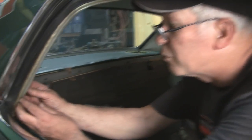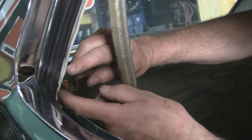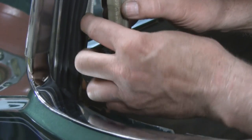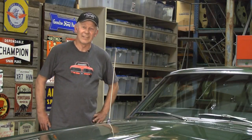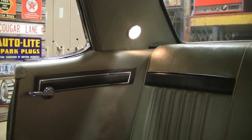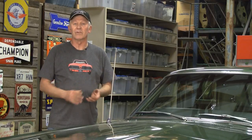One tip we learned while doing this: when you pull this loose where your headliner's glued in, you can kind of pull that glued edge loose — it'll give you a little more slack along that bottom where it was so tight. Then you can just take some self-adhesive and glue it back on and put your windlass back on. As you can see, it is tedious, it does require patience, and it is kind of difficult to feel your way around in there. But the end result is nice, it really looks good, it makes a real nice light in the car. If you still have your factory stock headliner it can be even a little harder because it's stiffer, but it's just a little patience. Thank you.